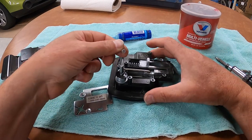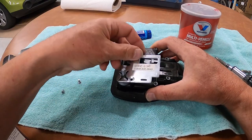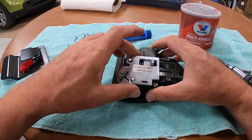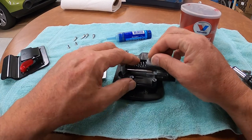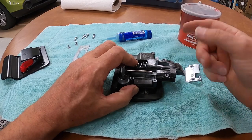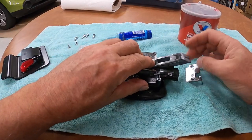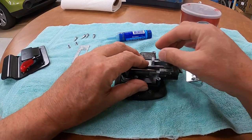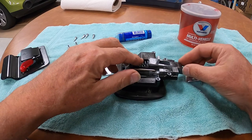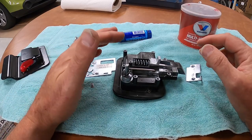So what can happen is these screws that you saw me take off, let's put that back on. If this screw and this screw come loose, this plate comes loose, and this guy tips up and jams. You see how that stuck out into that jam? There's nothing you can do on the outside with the key lock when this guy is tilted and jammed. It has to be down like that. You can see that if this plate comes up just a little bit, it loses capture, and you can no longer open it. So what we're going to do is, it's all apart now.